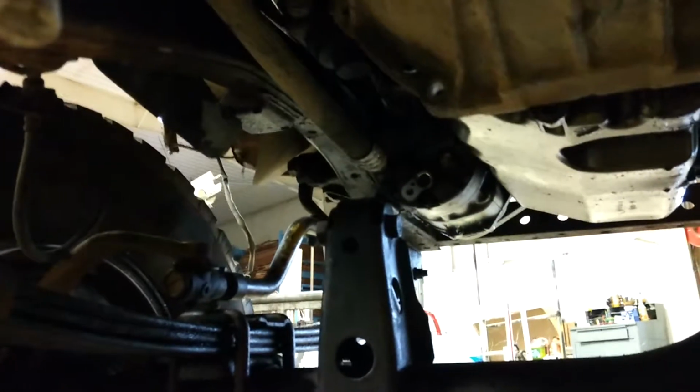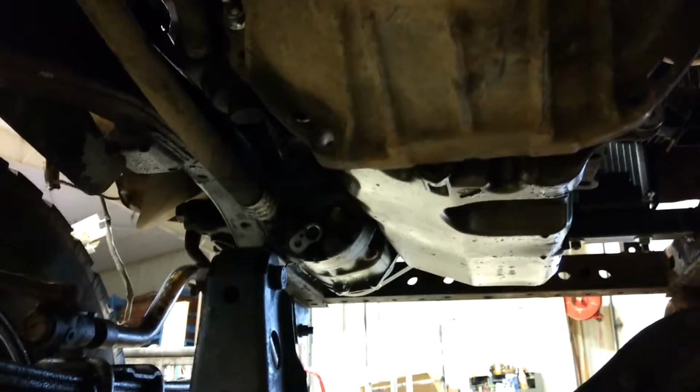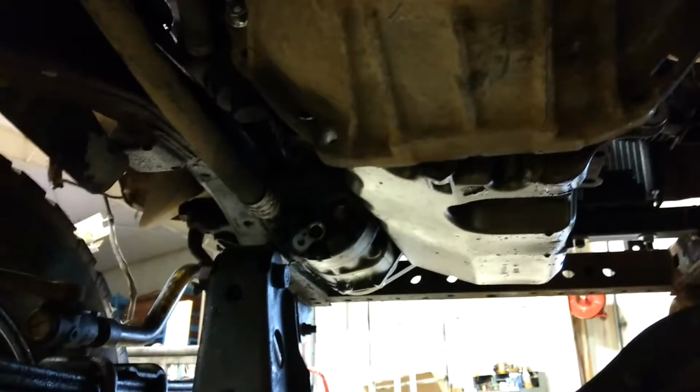As you can see, it's dangerously close to the AC line, so before I start flexing, I'll have to take that AC line off, since I'm not using it anyway right now, and I'll have to make some caps to cover that pump, just until I get that pulley replacement that Daco sells, just a rolling pulley that sits in its place.